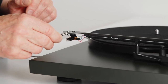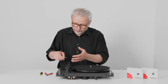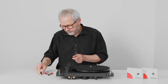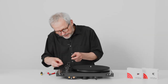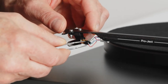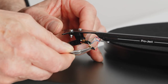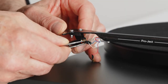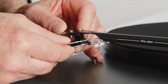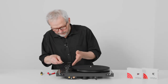I will now take off the headshell wires. They are pretty fragile — we have a thin wire, and if the wires are old or this is an old turntable, they might be even more fragile. Use a pair of tweezers or some kind of needle-nosed plier. I would take the wires one by one and take them off, being aware only to grab the solid part, not the wire itself. I'm grabbing this black part, taking them off one by one, making sure I'm not really destroying anything. So now they're just hanging there — they are color-coded.